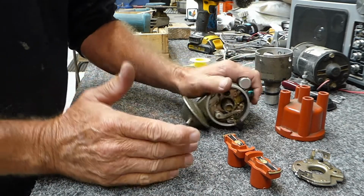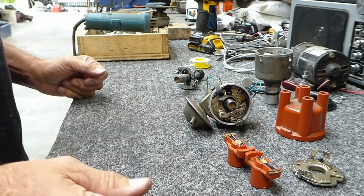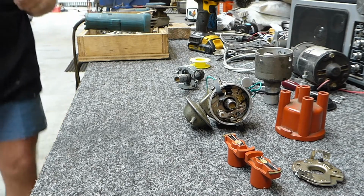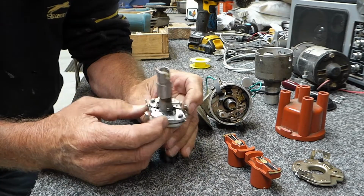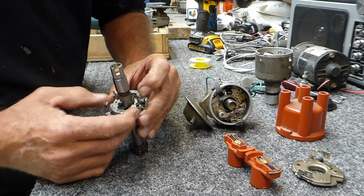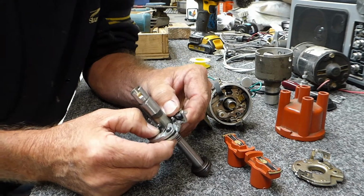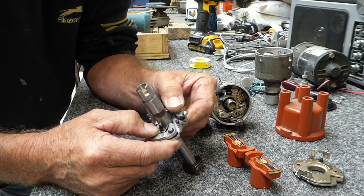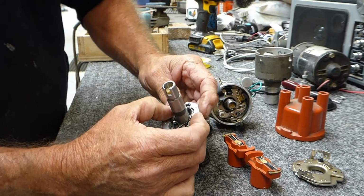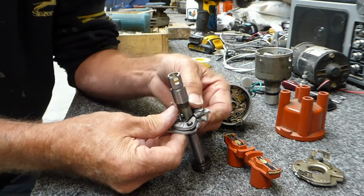So to get 17 advance so that it's not going over 30, you really have to, I've got some pliers here, no I haven't. What we need to do is to get these, and there's your throw. So to minimise that throw, let's say 10 to 30 degrees is 20 degrees throw. That's 20 degrees. So what we've got to do, squeeze those in and knock off at least 7 degrees of throw, so it's getting 13 degrees of throw.